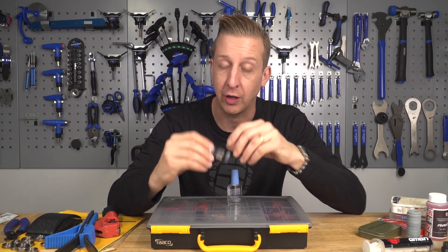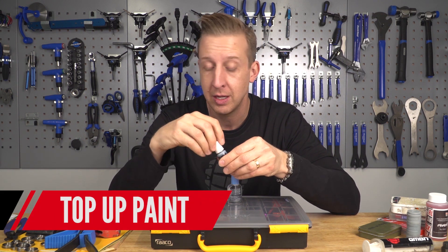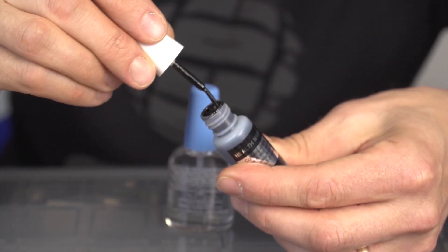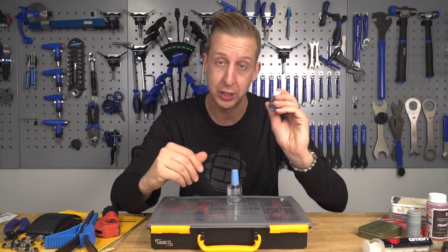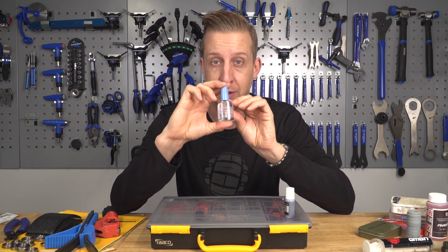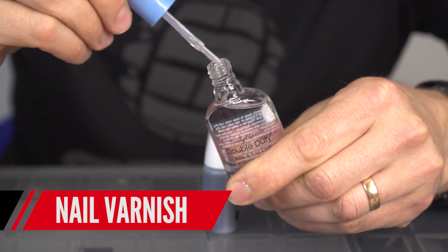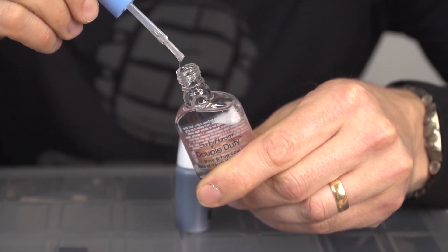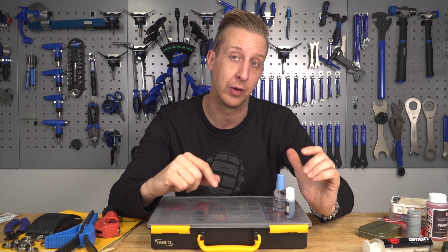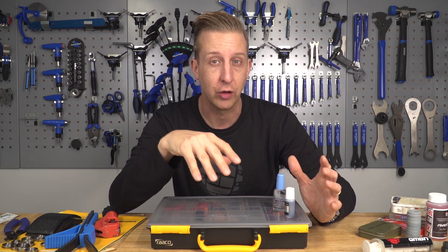This is my little frame touch-up kit. Ideally your bike would come with touch-up paint, but you can get a fairly good color match for neutral colors like black or navy to top up chips and keep your bike looking fresh — especially good if you're planning on selling it. If you can't do that, the next best solution is clear nail varnish or any lacquer. It's quite hardy, dirt cheap, and available in any homeware or superstore. Really useful, especially for steel frames where chips through the lacquer can lead to corrosion.